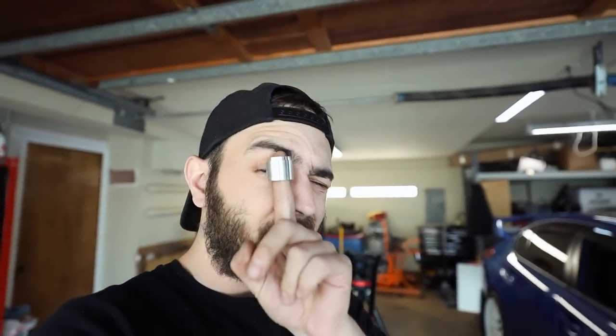All right, I'm back from lunch. I also got the bung in for the radiator drain, so I'm gonna go ahead and get a nice hole drilled for this guy. This is 1/2-inch NPT, so I'm gonna get the hole drilled so that way it's just ready to be welded in. I already know where I want to put it, so let's do this guy next.